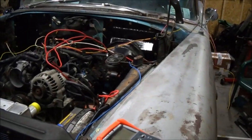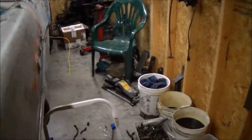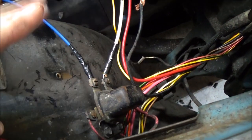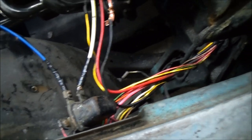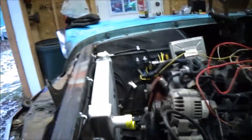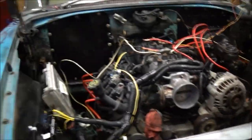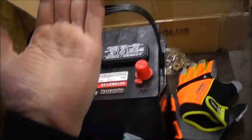It is December 30th and I've got a long weekend ahead — going to be working on this probably most of the weekend. I've got a lot of wiring to figure out. I decided I'm going to completely forget about trying to make the factory wiring work because apparently the starter relay isn't working, and you can't buy one of those — it's kind of a one-off thing for the Buick, a weird starter solenoid. I'm not going to rig up a horn relay for that; I'm just going to use a regular newer-style relay and wire up a horn button.